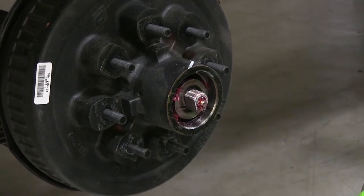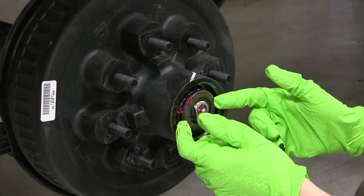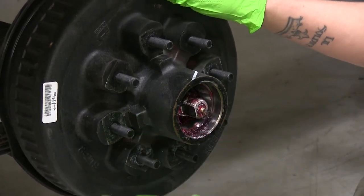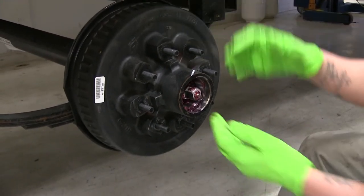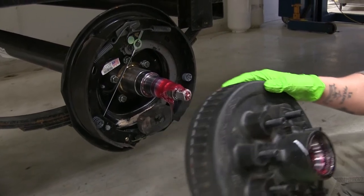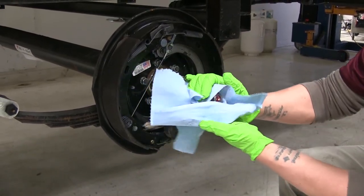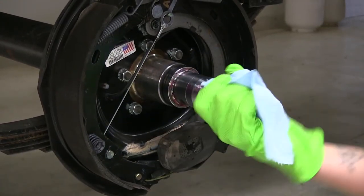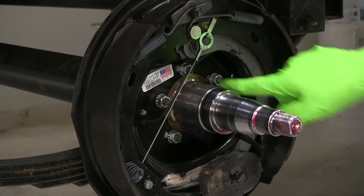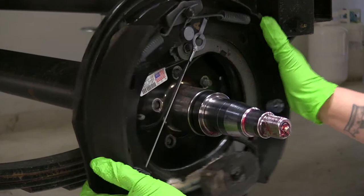If you're having a little bit of trouble grabbing it, what you can do is you can just reach in, give the drum a good wiggle, and it'll start pulling everything out for you. You want to be careful because the bearing will come out too. Just pull out the drum just a bit and the bearing will fall right out. Once we have the outer bearing and everything else removed, we're going to carefully remove the drum assembly and set it aside. At this point, I always like to clean off the spindle and inspect everything for any kind of gouges, any heat marks, or any kind of damage. So get a rag and wipe off any of the excess grease and check the entire area and make sure it's in good condition. Our brake assembly is going to be held on by these five nuts, so grab a 9/16 socket and pull them out. Once you have the nuts removed, you can pull the brake assembly down.